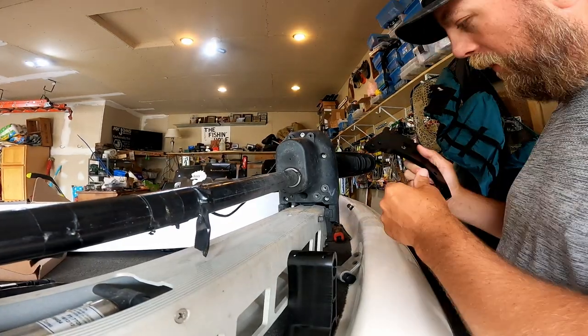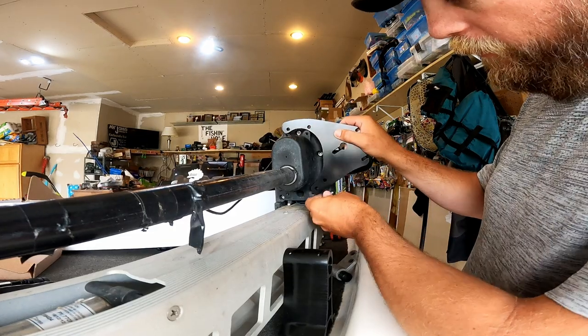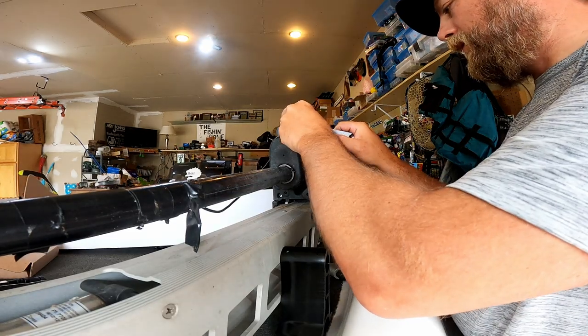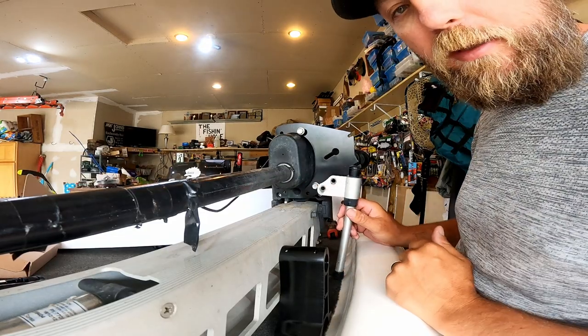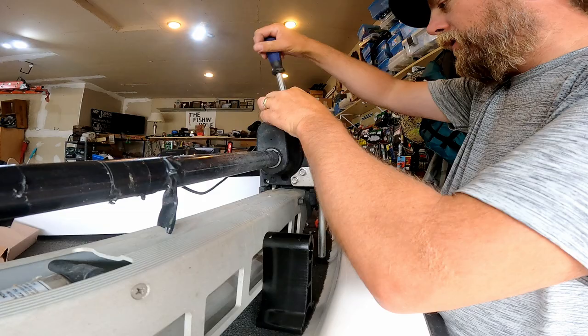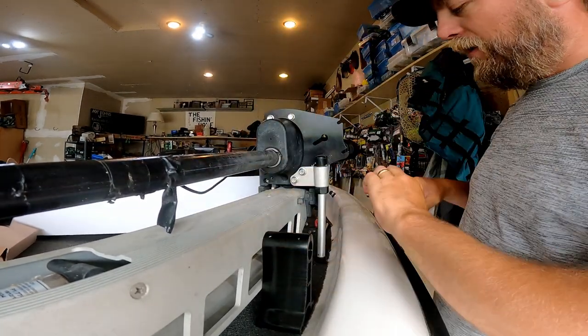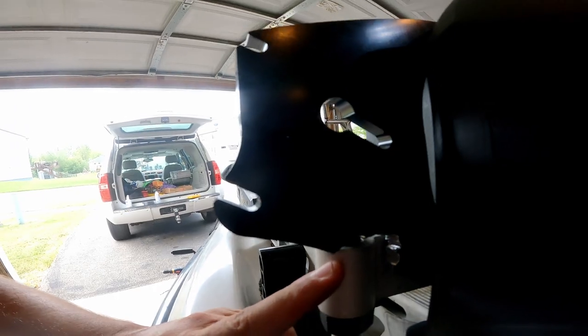One of the first steps is to get this bracket on it - it can only go one way. The bolt holes go in here and they give you four bolts that only fit in the right size holes. If you've got a bounce buster like this, you'll take that off and remount it to the outside of these blocks. Have a half-inch socket or wrench for these bolts. I did have to make a little modification for clearance on this - just had to take a little bit out of that aluminum plate. If you have a bounce buster you may have to adapt it, use spacers, or use longer bolts.